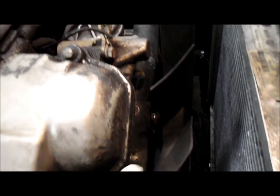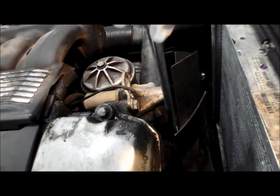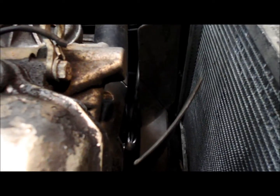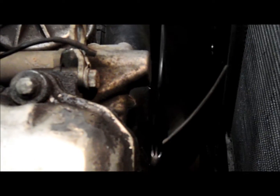What that means is that instead of tightening the fan when you turn it to the right, you're actually loosening it. So you want to put your wrench on the fan itself, and you're going to need a special tool to get in there, which holds the water pump from turning around. It's a tool that looks just like this — it goes down inside, connects onto the four studs that protrude out, and then you turn it clockwise to remove it. You don't turn counterclockwise.